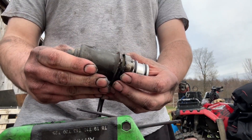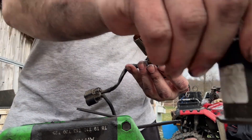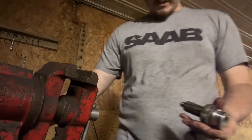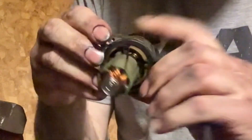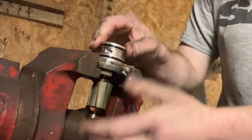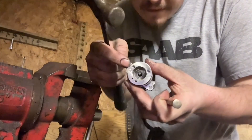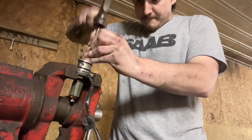This is what's called the stator. It stays stationary and it has magnets built in, so it's going to be a little tough to pull off, but it's just because it has magnets on the inside. Now we're down to the bare bones here — this thing is worn down pretty good. We are going to go ahead and take out the rotor. What we're going to be using here is a vise. You take this and put it so that this section of the metal and this section of the metal are sitting on top of the vise and the rotor is hanging down and not hitting anything. You're going to need a light duty hammer and a long skinny nail. There's a shaft you'll be able to see on the inside — it's sticking up. Put the nail in here and go ahead and tap that shaft, start pressing it out.